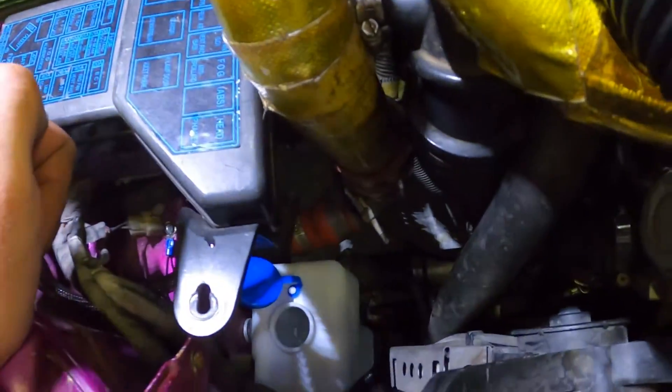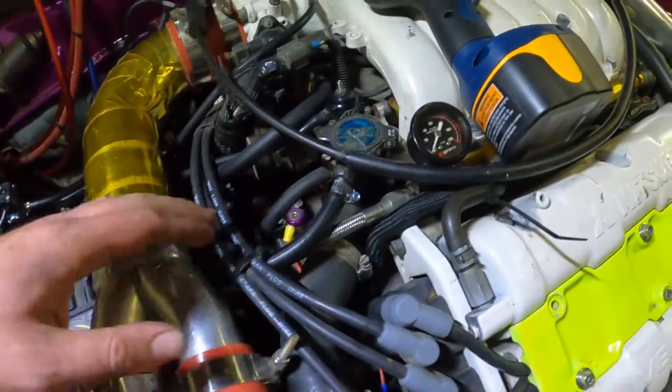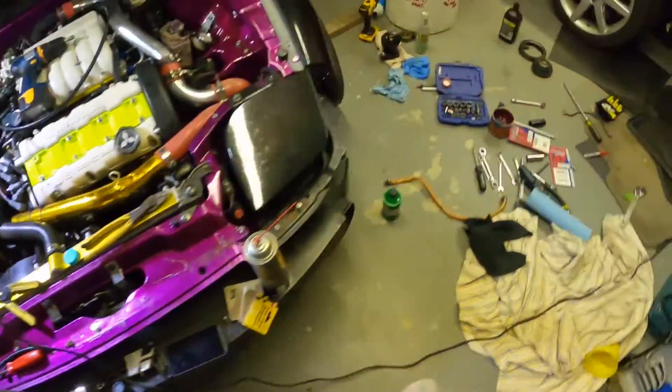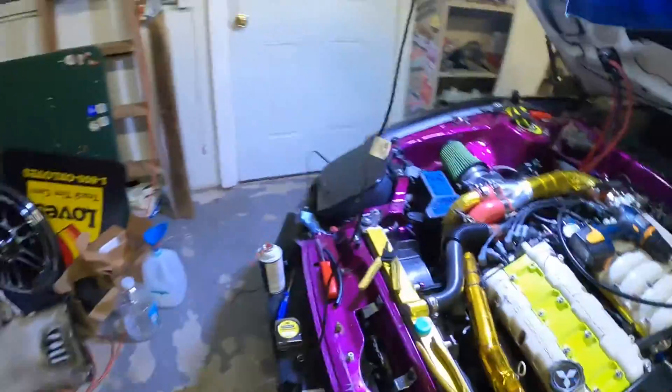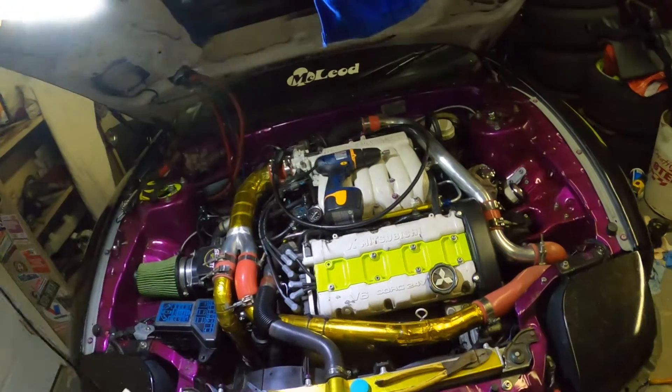All right guys, it's finally time to start putting this thing back together. Looking down, we got the tank wired and plumbed, the rad overflow tank down there, and the catch can. This thing is all buttoned up in a convenient location — I just have to bolt the fuse block up and this little fan speed switch. I have it wired to my fog switch, which is convenient because it's technically a fogger, and it sprays right onto the rad. End goal: fill that tank with ice and water, run the switch when I'm done with a run coming back through the pits or sitting on grid, and it's going to spray the hot section of the radiator right there.